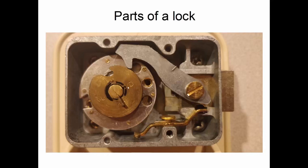The drive cam is controlled directly by the dial. There's a metal rod in the middle that connects it directly to the dial, locked in place with a key. So whenever you turn the dial, the drive cam moves at the same time.